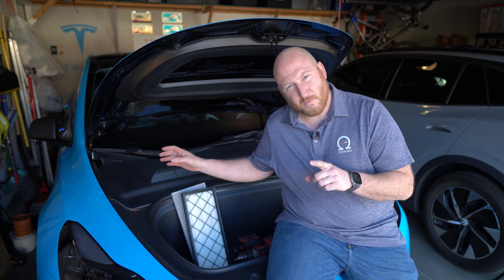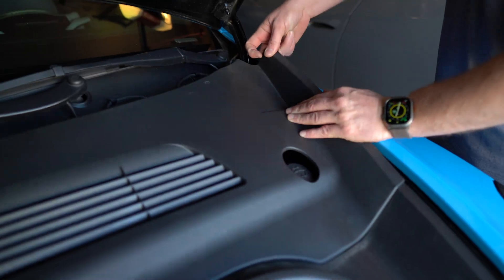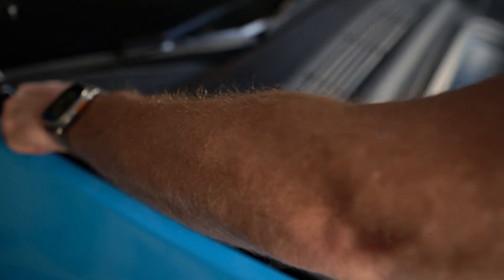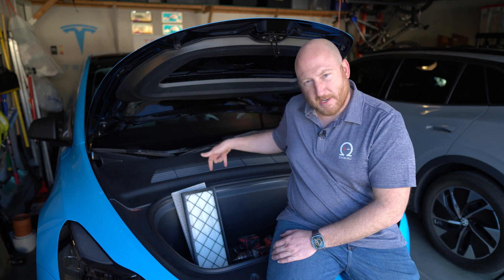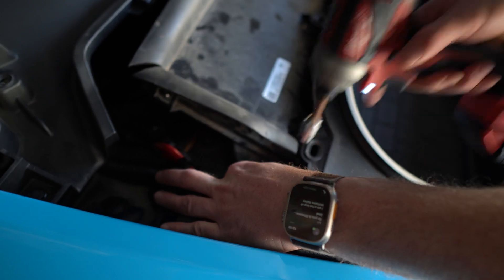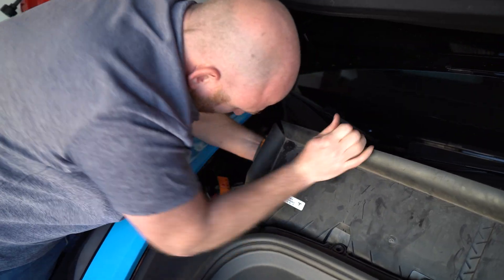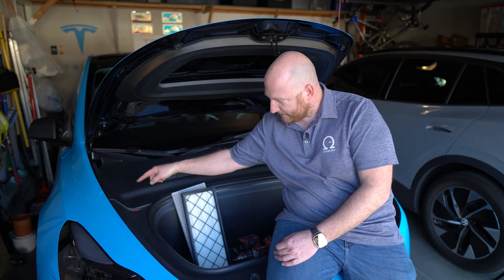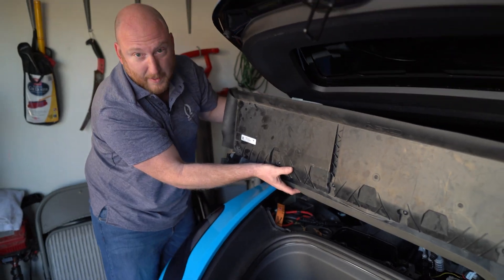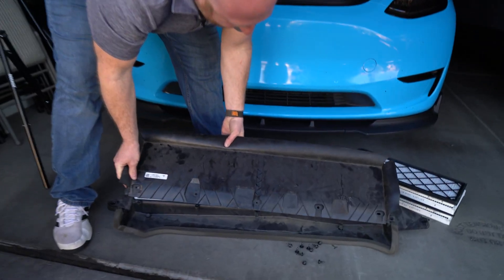The process for replacing these filters: you're going to remove this plastic liner trim right here at the top — it just pulls straight up on both sides. You pull one side up, get it loose, then go to the other side, pop that up, and remove it. Then underneath is going to be the filter cassette cartridge. You'll remove one 10 millimeter bolt on this side and one on the other side, then work that cassette up to the left, watching out for the wires. Then slide the whole thing out, open it, swap the filters, close it, and put it back in the same way in reverse.